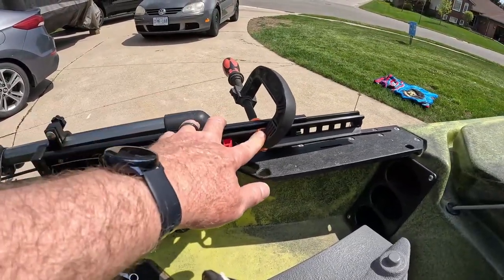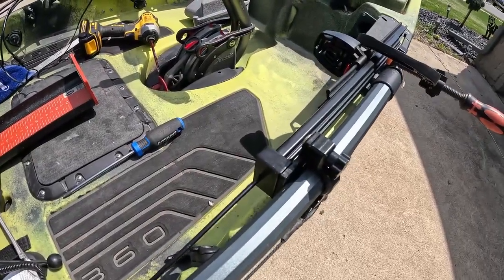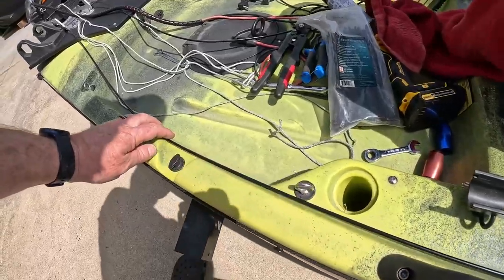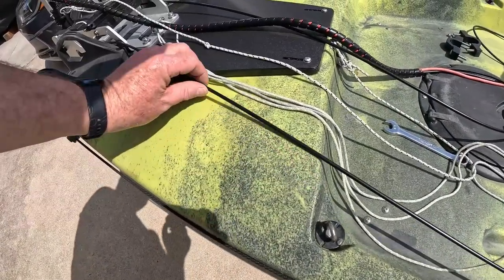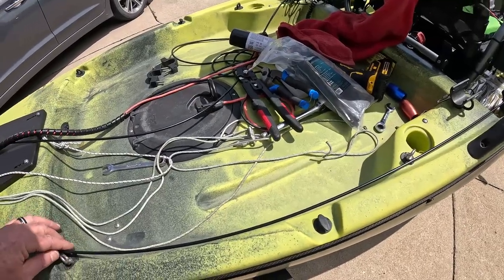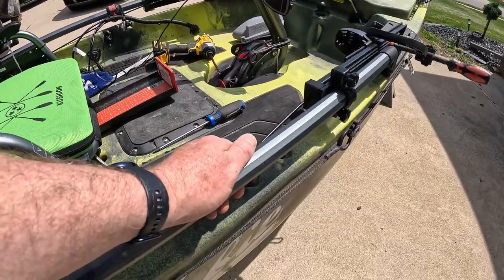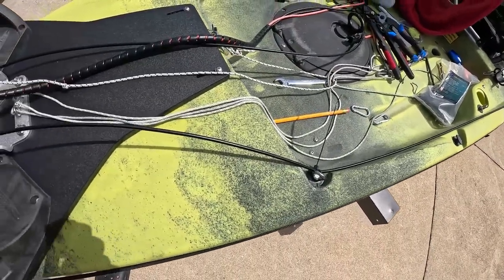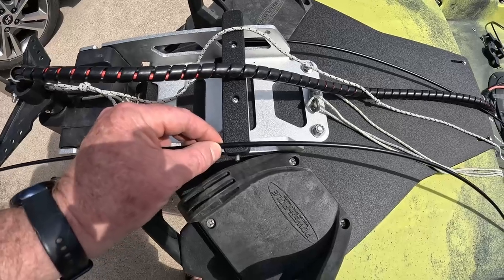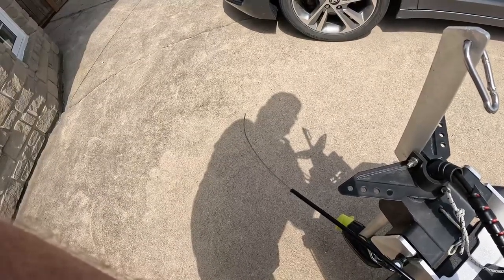Once I like the position, I clamp it in place to secure it. With the pedals in their position, secured and locked down, I trace my cables back along the route I want them to lay. Once I have an idea of where I want them, I'll start wire-tying them secure. I like to use pad eyes at the back and another one up at the rail. Once the cable housing run is secured where I like it, cut it to length. Mark the spot, and don't forget to back the cable out so you don't cut it.